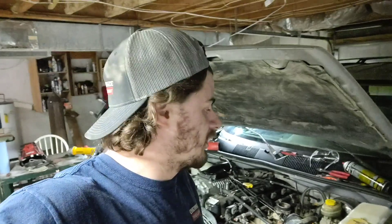Well, that's all I'm doing in this video. It's running pretty good. I need to order a blow-off valve or a circulating valve, some aluminum tube — I already have some couplers. On the next one, hopefully I'll get that stuff in quick so I can finish and actually tune it with boost. I'm surprised the short-term fuel trims are so close. I still haven't looked up what size these injectors are — I just knew they were big and free. Thank you for watching, please like and subscribe, and I'll keep moving forward on this project. Hopefully this gives you some ideas of what to do and what not to do.